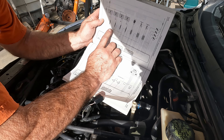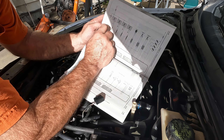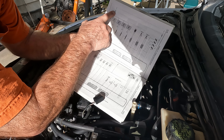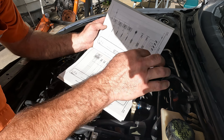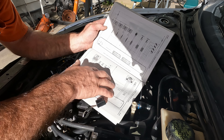Green, yellow, green — what is L? Blue. Green, yellow, green, blue, green, red, green, brown, black. Although they all splice together, they're all different colors. So we can make the assumption that the green base color goes to ground — actually it looks like it goes to power, to a fuse. I could trace it back, but I just have to make sure I stick with the right polarities on the new connectors. That's the short story.